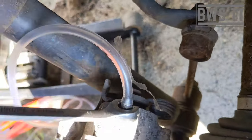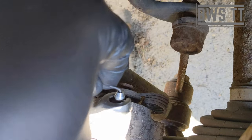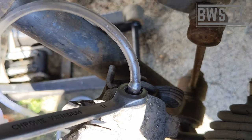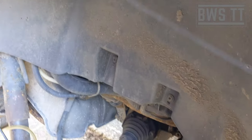This one's tight. That's not doing anything — my guess is there's a bit of a blockage in the nipple. No, the nipple feels fine. This could be lots of air being pushed out, who knows. Try and push the pedal and film — there we go, kickstart the process. Yeah, it looks alright now, so we'll just leave that for a minute or two. I'm going to leave it until about 250ml has gone through the system to make sure there's no air in that line, then I'll move over to the other one.